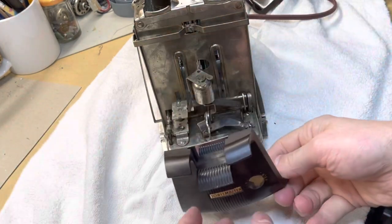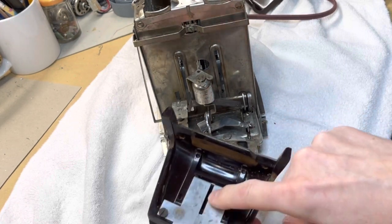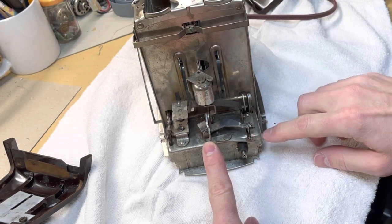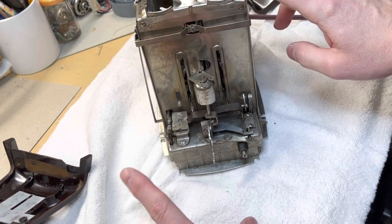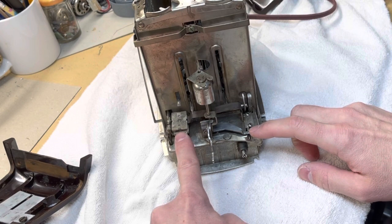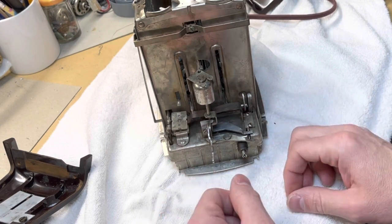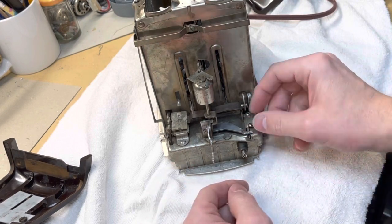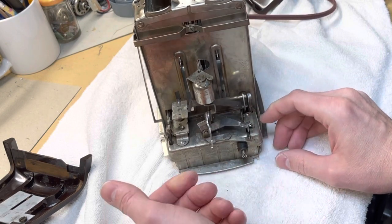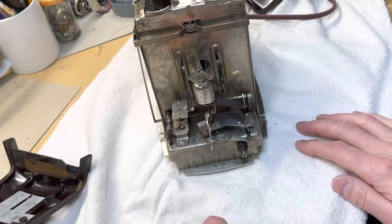Here's a quick way to show you the operating mechanism of the latch. The Toastmaster Bakelite piece was on the front and this lever would slide down in this slot - this arm would go down, and when you push this down you'll see this arm come down and a little latch will catch it. This little catch holds the arm in place, the electrical contacts come down and begin the heating process. As the bimetallic strip heats it bends and pulls back, eventually releasing and allowing this piece to come back - that separates the electrical contact and keeps it from staying on.